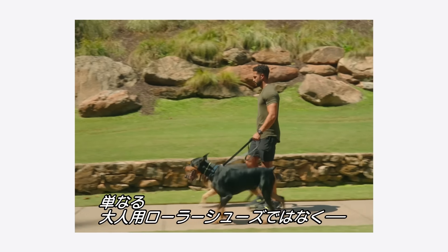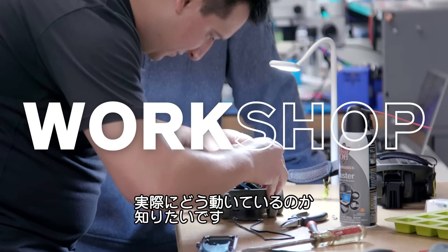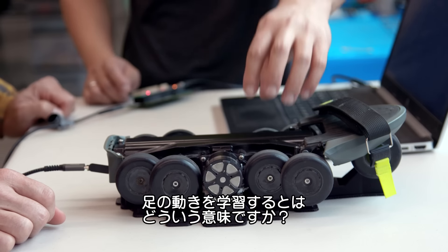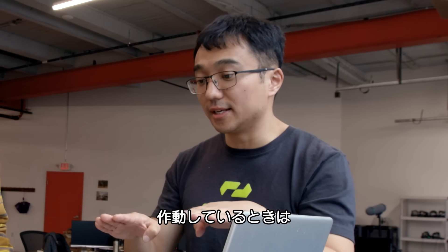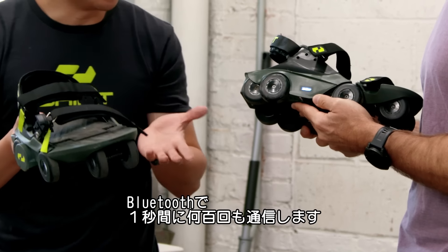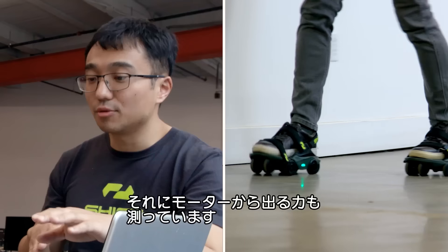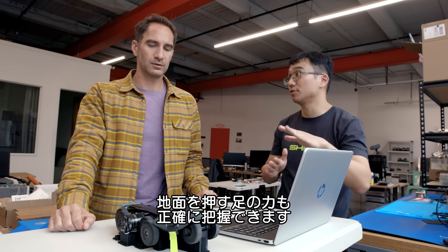These things are pretty fun, but they're not just Heelys for grownups. They're powered by brushless motors and some onboard machine learning. The AI drivetrain sort of learns from you as you go. There's an IMU sensor inside which basically detects how your feet move with each other. When in operation, the two Moonwalkers communicate with each other in real time via Bluetooth at hundreds of times a second, figuring out where the shoes are relative to each other in spatial relationship. We're also looking at the force coming from the motor, so we know exactly how much force you're pushing off the ground.